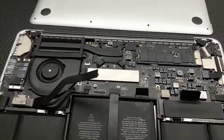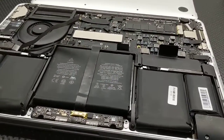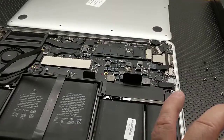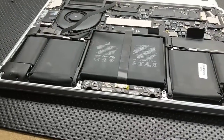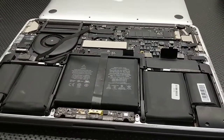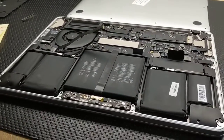Moved the board back onto this unit and found we had a bad battery. It was showing a percentage but really wasn't holding any charge — it would immediately just turn off, and it also wasn't charging. Bottom line: the battery was bad. So went ahead and ordered and replaced the battery, and then we found that the unit would not turn on with the power button.